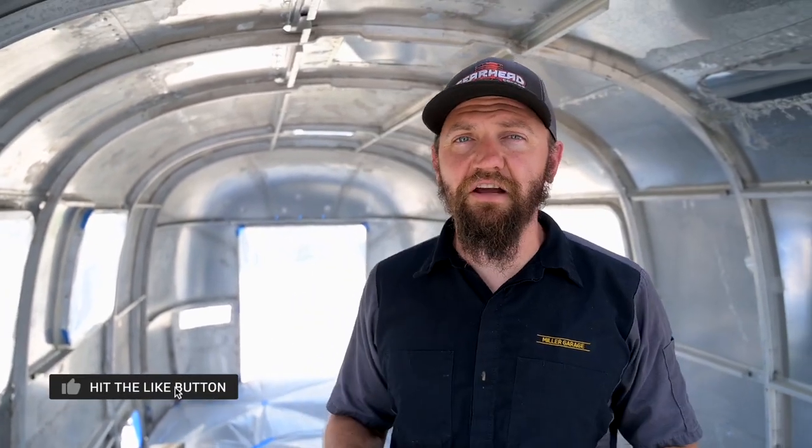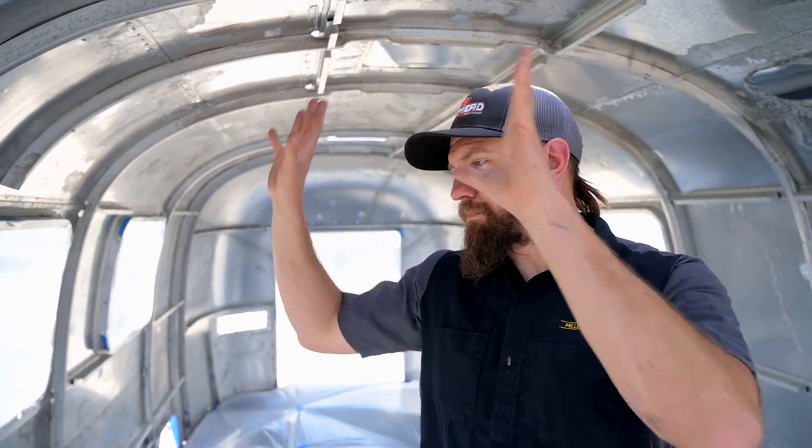With this particular trailer I wanted to try something new and different — we're actually going to be testing out a product called Lizard Skin. It is a ceramic insulation coating, similar to what is put on the roofs of RVs, but this stuff is designed to be used in cars and hot rods. It's used a lot of times on the firewall. The whole objective is to prevent heat from coming through. One of the other benefits is that it actually is a sealant as well, so putting this membrane on the entire inside of the trailer is going to be sealing all of the seams in addition to insulating.